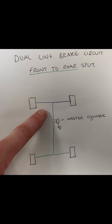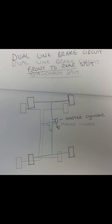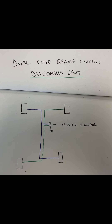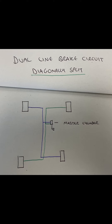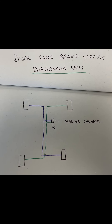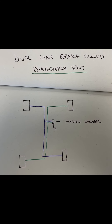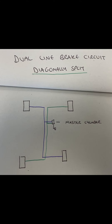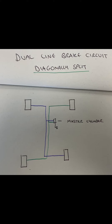Having this, your front brakes are now the emergency brakes. The other type of dual line brake circuit is the diagonally split. It also uses a tandem master cylinder where two brake pipes come out. From here you can see that the green brake pipes go from the near side rear to the off side front, and the blue brake pipes go to the near side front and the off side rear.